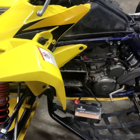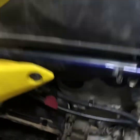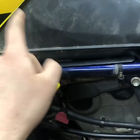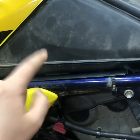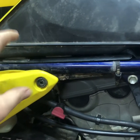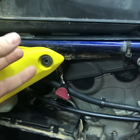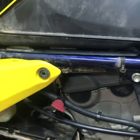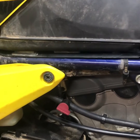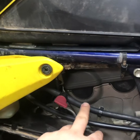So pretty much to wrap this video up, here's a quick rundown of what we did. You have your swirl filter that's in here underneath — we just took the fuel swirl filter out, that's all we did. We left the housing still in there but we just took the filter out. We're not going to be spending $50 a filter every six months. So we deleted that and then we just ran our hose like it's supposed to, got a little fuel shut off there.